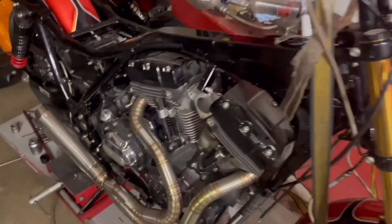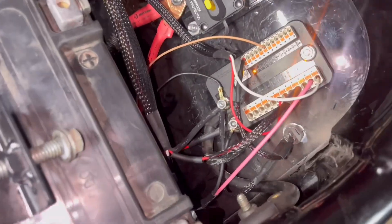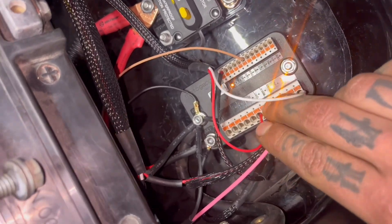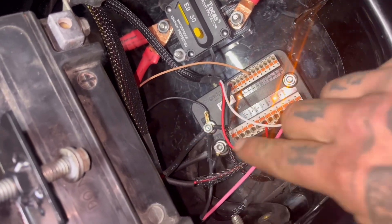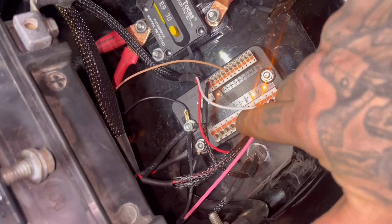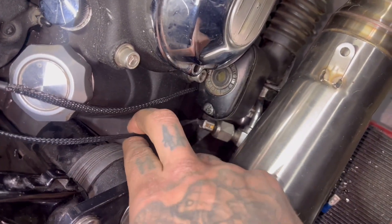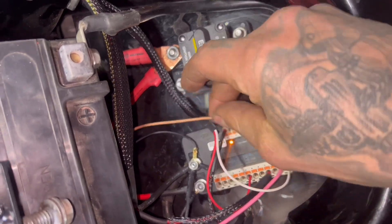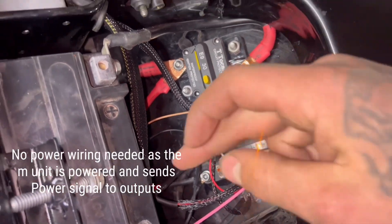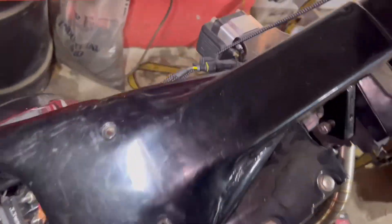Most accessories are just two-wire or three-wire setups. Brake light is the same thing — the M unit makes it super easy. You have your red trigger come off the brake section; these are your inputs and these are your outputs. Grounds come down here. Your output for your brake goes here, your switch comes off that. I made a harness: one's your ground and one goes to the switch for the brake input. The input brake receives the signal, output brake goes to the brake light and activates it.